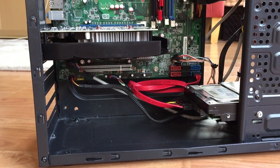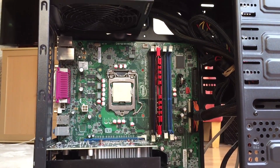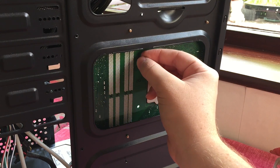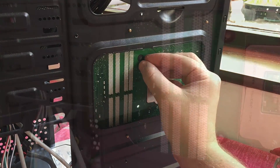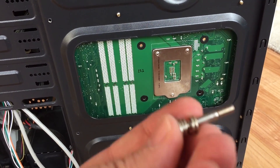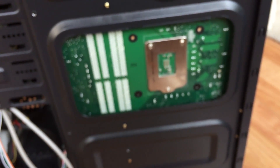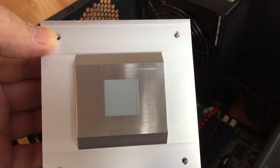But today we're focusing on what is probably the cheapest no-noise option. Installation is pretty simple: just take out the washers included in the package and stick them over the holes on the back of the motherboard. It's overall an easy process but quite fiddly at the same time. All you have to do after applying the washers is put the little springs on the screws and line them up with the holes on the bottom of the heatsink.